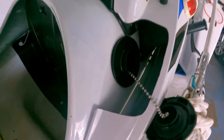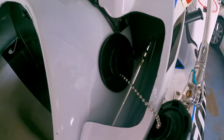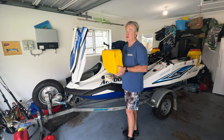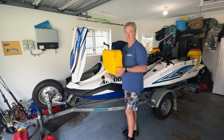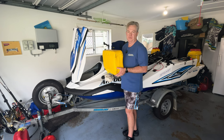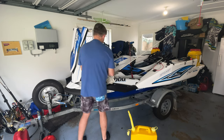That's the outlet to my second tank — there's the standard tank entry point and here is the auxiliary tank just above it. I'm topping up the auxiliary with about 10 liters, so I'll have a total of roughly 80 liters, which will give me about 160 kilometers of cruising. You can burn between 15 to 25 liters an hour depending on speed, and it's not a big speed difference — maybe 20 km/h — but you'll get 20 to 30 percent more fuel burn. Remember to put your caps back on.